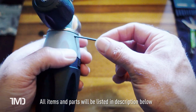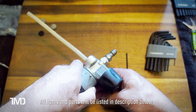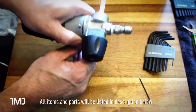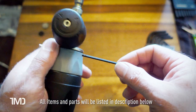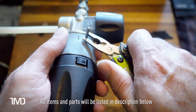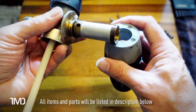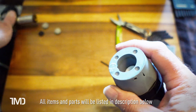Switching to a 2 millimeter allen key gave a looser fit but more leverage. After stepping away from the camera for better leverage, the pin finally came out enough to grab with pliers and pull out the rest of the way. With the linchpin removed, pull the barrel apart from the brass housing just like with the MJJC — it's held on by a rubber O-ring at the base.